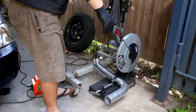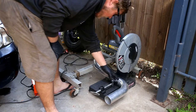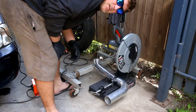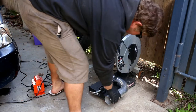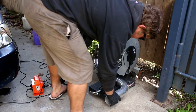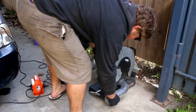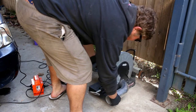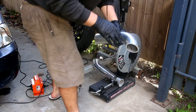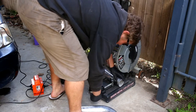So a little tip, when you're cutting things and you've got one of these swivel jaws, if you've got to try and take a sliver off whatever you're working with, then you can grab another piece of your work material that you've got floating around the shed and space out the other side of the jaw like so. And with any luck, this will just glide through. Might help if I turn it on, eh? Relatively clean cut, but this is what the Dremel is going to come out for in a moment as we take all these burrs off and clean this material up.